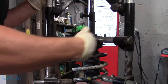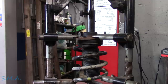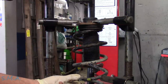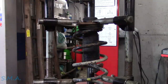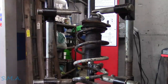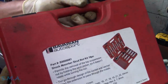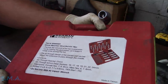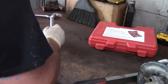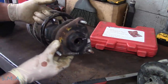There she is — now we're going to relieve the tension. We're putting new springs on both sides so we don't want the car sitting cockeyed. Back this off and take the tension off. Be mindful of how you have your spring set up on the bottom and on top because it'll make going back together a whole lot easier. This compressor — not sure who makes it — the Bavarian Autosport part number is BRAVO 88-000-81, in case you want a nice bit of kit. I've broken a few of the tools in it and haven't had a chance to contact them for replacements.